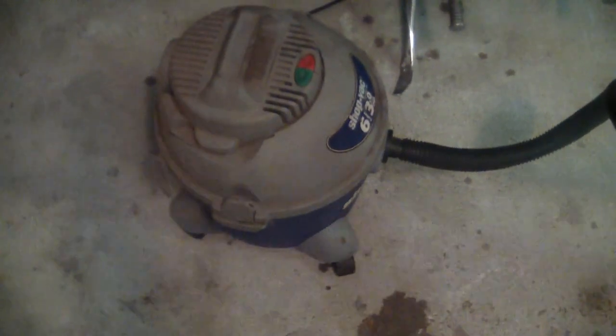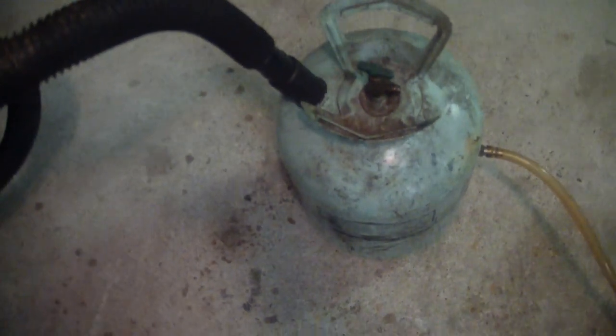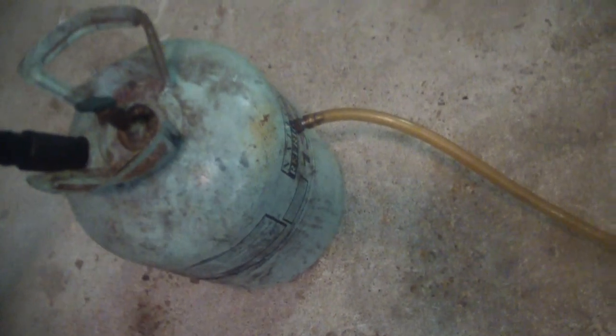I've got a shop vac and an old Freon tank - drilled a hole in it, got the hose running in the top, got a nipple sticking out the side with a clear hose hooked to it. It's sectioned together and it's longer than the dipstick so it should reach the bottom of the pan. I got the truck jacked up in the rear where all the fluid runs to the front, that way when I suck it out it'll get just about every bit of it.